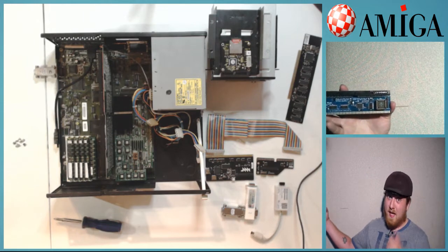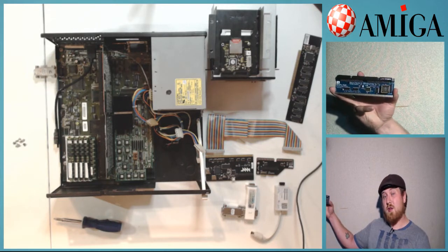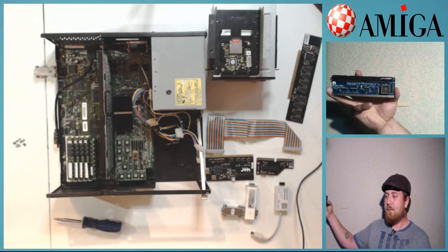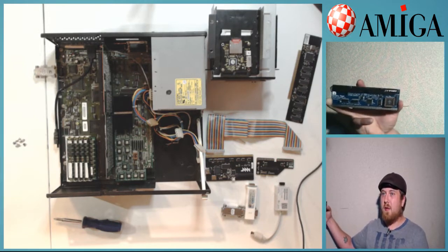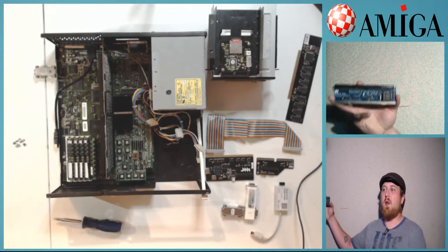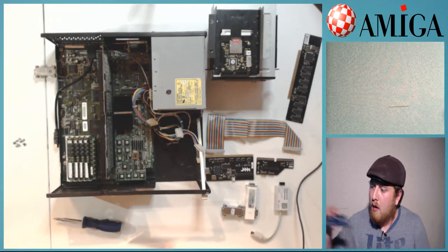So there is a Rapid Road for clock port, and if you get a Buddha, which this Buddha 25th anniversary is roughly about 80 pounds or $80 US, that means that for another $100, you could put a Rapid Road and give your big box Amiga IDE or USB support without having the expense of the Xsurf, which is awesome as well.